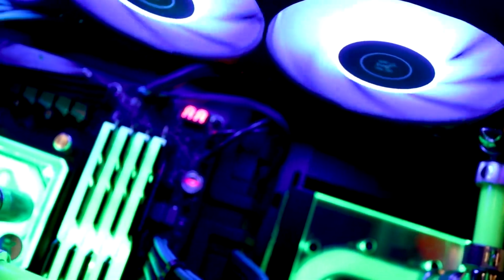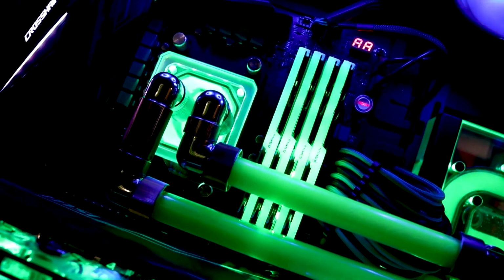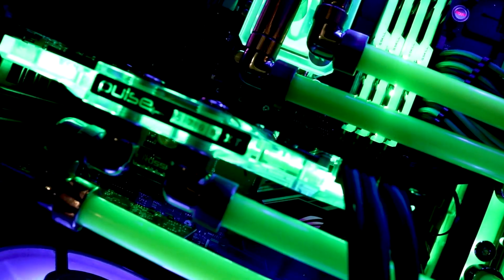We also did use a lot more fittings than would be expected in this kind of build because the tubing length necessary to do this is kind of extreme. If we were to actually do our bends and possibly mess them up, I would have had to pay a lot more for tubing than I did. And wasted plastic is still wasted plastic. So the way that we did things, I ended up liking, but it still runs a lot of risk due to the fact that every fitting is a potential point of failure.